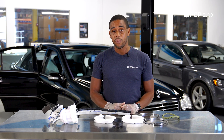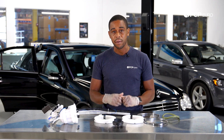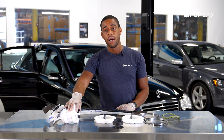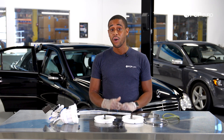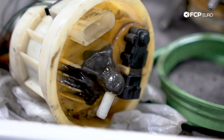If you decide you're going to also be replacing your fuel pump, you might find this video very helpful because we're also going to go in and remove the fuel pump assembly. The reason we're replacing this fuel level sender is not because it's not operating correctly — the level sender is made out of plastic and it cracked and is starting to weep fuel vapor. This car has EVAP emissions codes, and we also found that a repair was attempted with an epoxy like JB Weld.